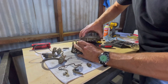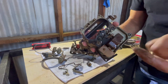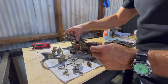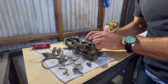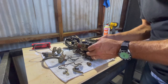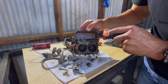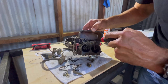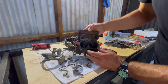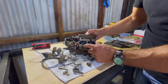You want to lift the top hat straight up and off. This baby's been on there for a long time — and she's gummy, real gummy. This thing would not have been happy to run. Pay attention because there are a lot of little parts and pieces — the power valve with a little ball and socket, and the jets down in here. I'm not an expert at carburetors but I like tuning them. I'm going to try to get all this stuff out; it might be difficult because of how gummy it is.